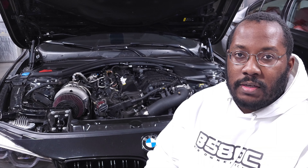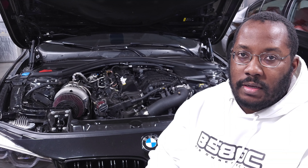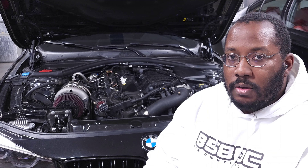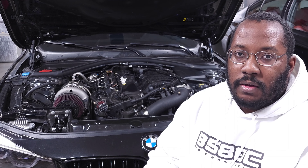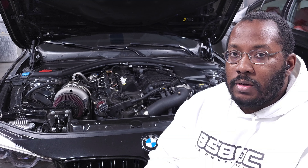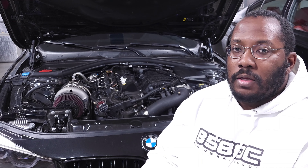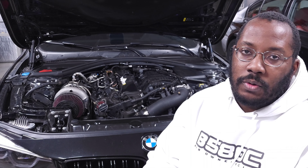The first and most important thing to understand is suspension is not a magic trick. The most important thing is having a really good tire setup. If you're drag racing or roll racing, you typically want a relatively small wheel with a relatively tall tire — that allows you to lower the tire pressure so you can get a really big tire patch on the ground and give you as much grip as possible, as well as help you accelerate more quickly off the line. A lot of what we'll talk about with suspension is just optimizing it for your tire setup, but if you don't have a good tire setup, don't expect suspension to magically give you gobs of grip out of nowhere.